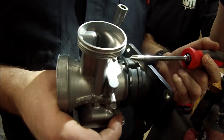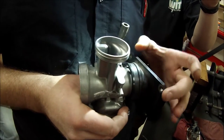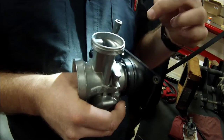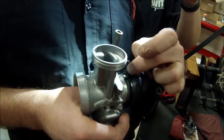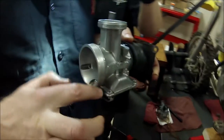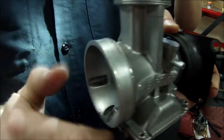It's a good idea to use some lube on an actual installation. When you put your clamp around here, what you're actually clamping is that lip going down into the groove of the carburetor. Also note: it's only on the engine side — on the back side of the carburetor, the airbox side, there is no machine groove.